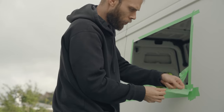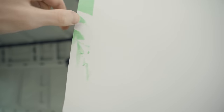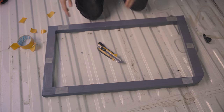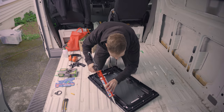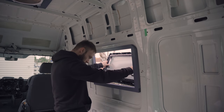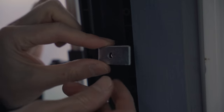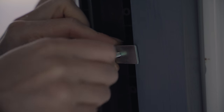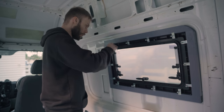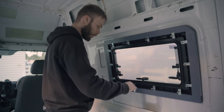I hadn't cut it wrong, but those smiles were short-lived because my masking tape had developed a mild case of spontaneous disintegration, which led to one of the most frustrating hours of my entire life. Moving on — with the edge of the steel prepped it's time to install the window. I'll temporarily hold the support frame with double-sided tape while laying a healthy bead of sealant around the flange. The install is easier with two people but if you don't have any friends you can still make it work — and then you drop it on the floor. These windows are designed for caravans with thicker walls, so the support frame gives the clamping fixtures something to grab.